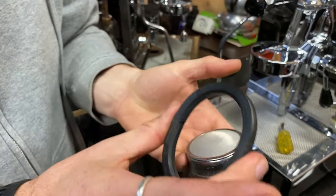Another common thing is people say the steam tap is leaking, but when we get the machine in, it's actually leaking right between the top nut and the bottom nut — not underneath or out the steam tip. This one here is squeaking, and that's because the grease has gone in the little ball joint. It essentially acts like a spanner and undoes that nut, so steam comes straight out between the two nuts. You can fix that yourself by just tightening it up. If there's a leak underneath, you'd need a new gasket or seal. If you're handy and have food-grade grease, you can take it off when the machine is totally depressurized and put a bit of grease in there — that'll fix the squeak too.